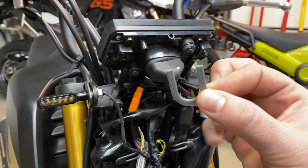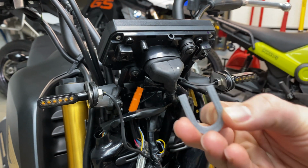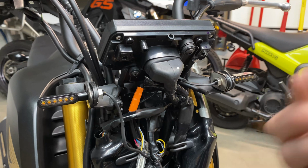So with that swapped, I'm going to wait for spacers to finish printing. It's about a 15-minute print after I got it all designed, and then we will finally button all that back up. Okay, super quick and easy print. It's just this little U-shaped spacer. Like I said, you could probably get away with cutting this out of cardboard or a really thin piece of metal, whatever. And it's about 2 millimeters thick.